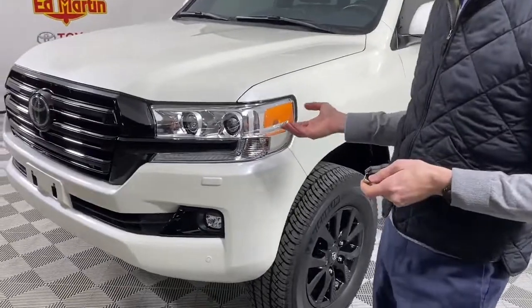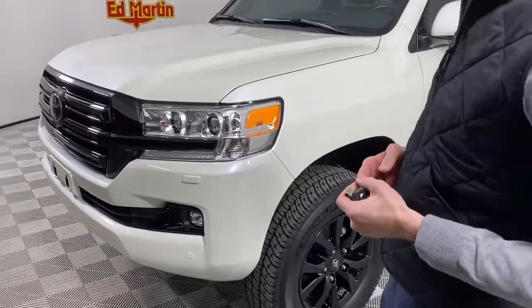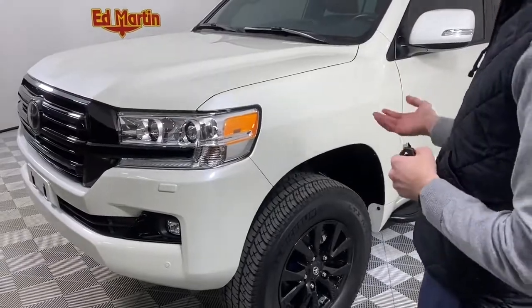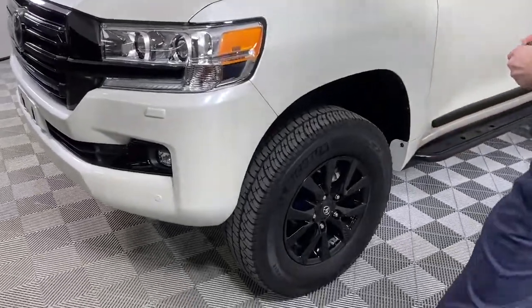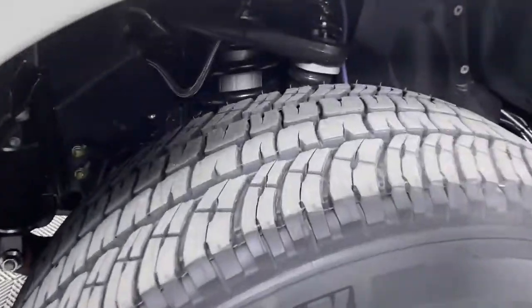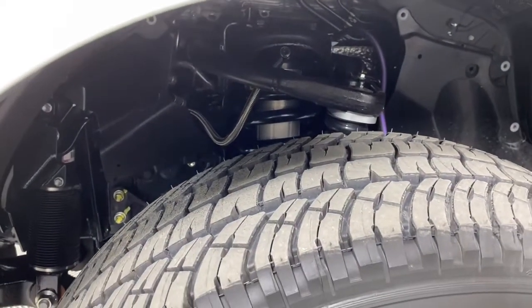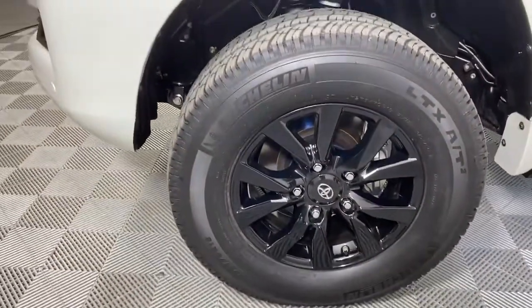This build was designed to be driven in Texas, kind of like a semi-off-road, corrugated, textured road. We wanted ultimate smoothness. We went with the BP-51 suspension, stock height at 2 inches out of the box, SPC upper control arm. The rears were sitting on 27-22 springs.